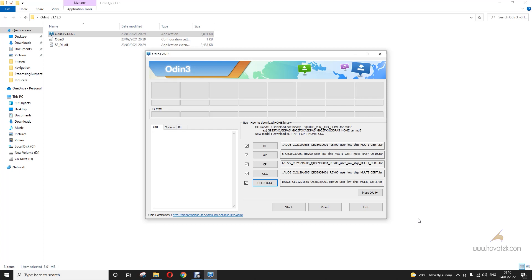Sometimes when you try to flash without doing a clean wipe, it might require a factory reset — it might or might not — so it's always good to back up your data when you re-flash your firmware. Also, when flashing in Odin, avoid flashing only the AP partition, because sometimes it might resize your user data partition. I prefer to flash a full firmware. I'll go ahead and put the device into download mode — I'll link to a guide on how to do that.